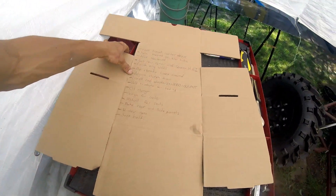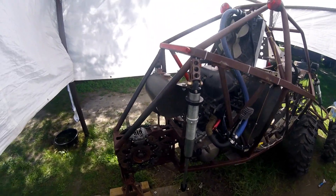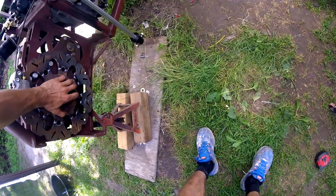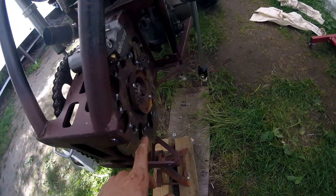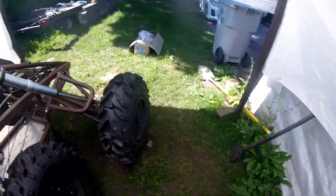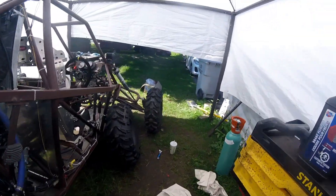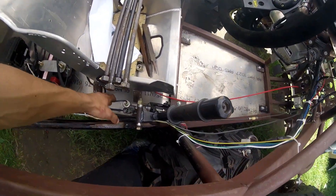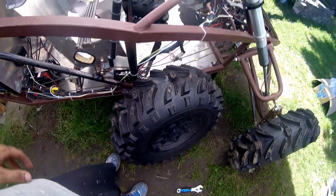I just got home from work and I went over to HAI and gave them the dimensions on our new brake rotor, so that's getting taken care of. Also a 1.8 spacer to go in here to offset our center rotor a little better. I ran the line and I got the pads today, so all four brakes work now, which is pretty cool. Other than the handbrake — I accidentally ran the fittings backwards and this one's actually leaking like a sieve. I might end up ditching the handbrake. It's an eBay piece of junk. When it's too good to be true, it usually is.